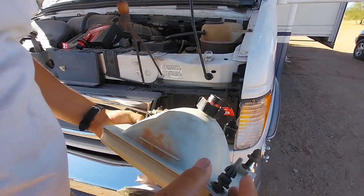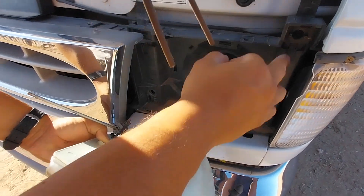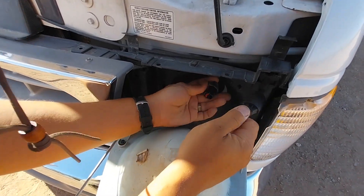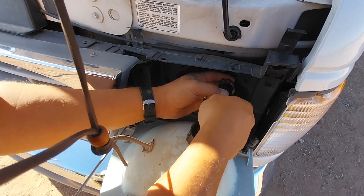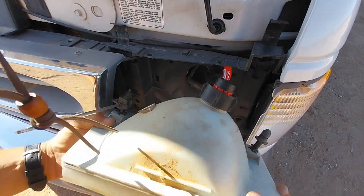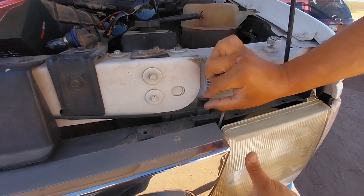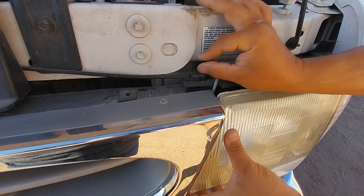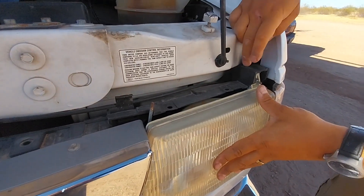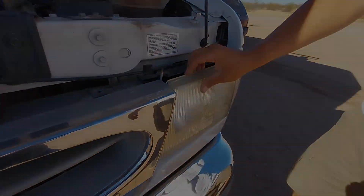Now we line these studs right in — there are three of them, one here, one here, one here, one down here. But first, before you do any of that, you've got to plug it in and clip it. Now let's get this headlight in. Once you get them all in the holes, match it up, find the groove, move the headlight slightly until it locks. Both sides locked — headlight's in there nice.